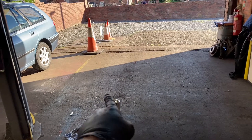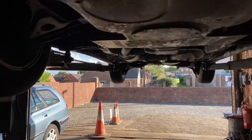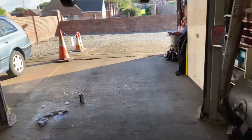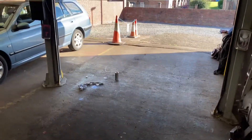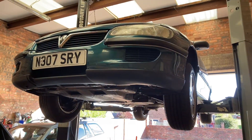So don't forget, when you are doing the wax oiling on your cars — which you spray on, as I've showed you in the 5 litre cans — always make sure to inject what you call cavity wax: bottom of the doors, boot liners, into your bonnet, inner sills, all areas that will have drains on. It gets inside all the box sections, inside of the sub frames. I think there are 3 cans with the applicators for £20 — spend about £40, get 6 cans, that'll do your average car. Just a short video today for that — I'll catch you on another video. Like, comment and subscribe. Bye.